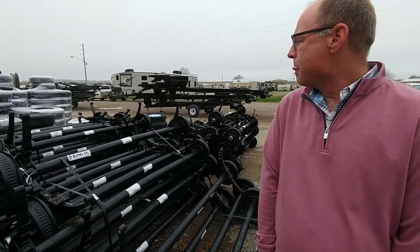For the most part, our units have 2,500 to 3,000 pounds of carrying capacity. When you look at the unit, you almost have to add the hitch weight to your axle ratings. So let's say we have a 2,500-pound hitch weight — you're looking at 7,000-pound axles, 14,000 plus 2,500. There's a little misconception out there, because when you stand and look at a fifth wheel sitting there, all that weight is not directly on your axles.